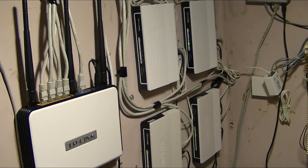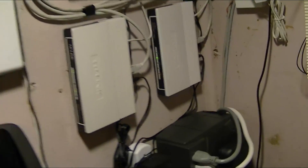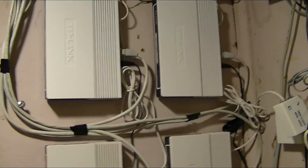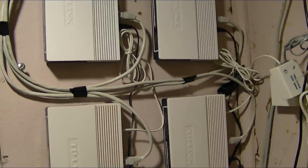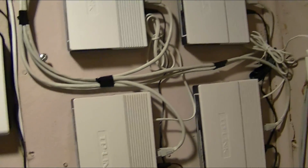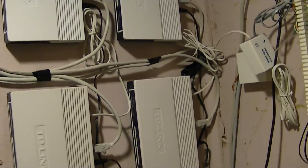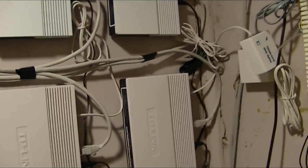In this particular situation, we have four ADSL modems that are set to five megs each download and 800K upload. So you're basically getting four times the speed — five times four is 20 megs down, and then 800 times four gives you 3.2 megs up.